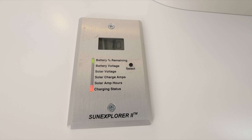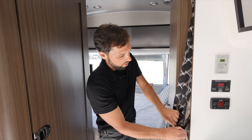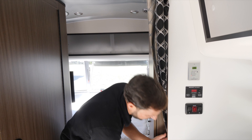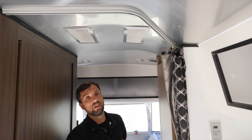There's a privacy screen that pulls across, giving you an area to get dressed near the wardrobes; it's cloth material and you strap it in when traveling so it doesn't move. The AC intakes are where air comes in — best practice is to clean these filters after every trip, as lint from towels can clog them and overwork or cause failure of the air conditioning.